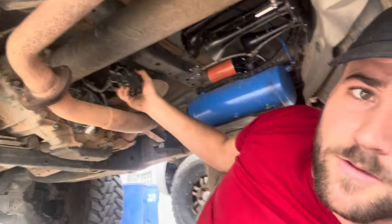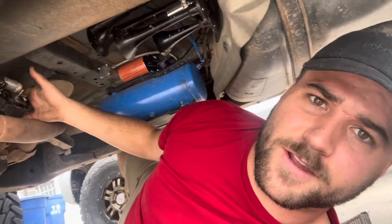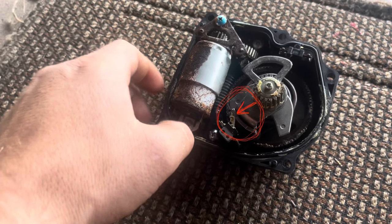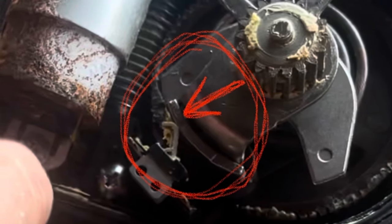Now I'm going to take all the wires out of here and pull it down so I can look at it a little further and then install that last cog. Just make sure this piece doesn't fall out because now it's perfectly set. I got everything put back in. I'll leave some still photos at the end showing you the position of that second little cog with the actual gear on it. Once you have everything positioned right after doing the accessory reset to the two-wheel drive position, you'll put it back in. You might have to pull it out and put it back in a few times just to get that spring tension exactly right. But once you do, you'll be able to hear it switching between two-wheel, four-wheel, and four-low.